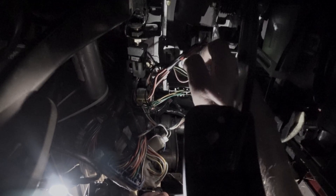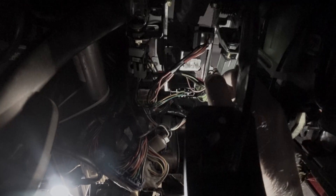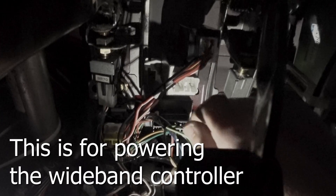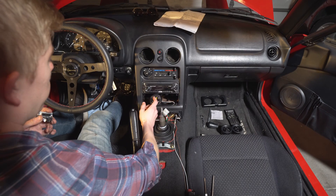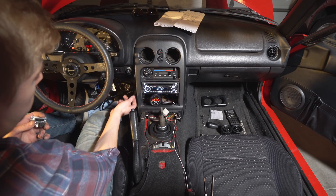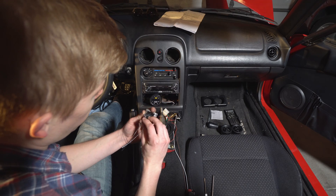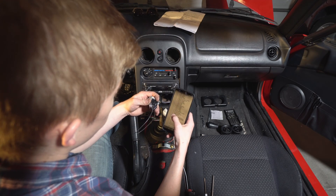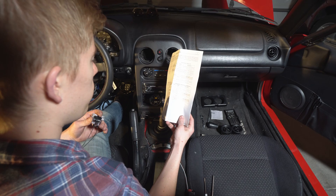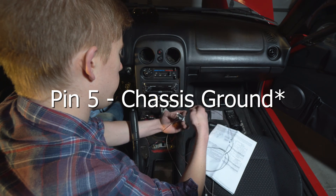We've got our analog signal running to the Megasquirt and now we'll wire in our power. Here's where I've disconnected the buzzer — awful noise. What we want is 12-volt switched, which is the black and yellow wire. We're going to cut a few inches off the connector and splice into that, and ground is black. So power and ground are routed from the controller to the buzzer. This powers on with 12-volt switched, boots up, and starts heating the O2 sensor. We go to pin 21 of the Megasquirt plug-and-play 2, which is the oxygen sensor input. We solder pin 21 to the positive signal of the O2 controller, and take the negative output — your ground — to signal ground of the Megasquirt, which is pin 22.